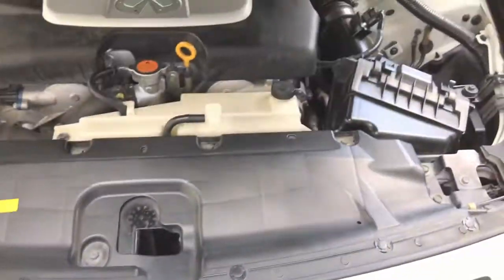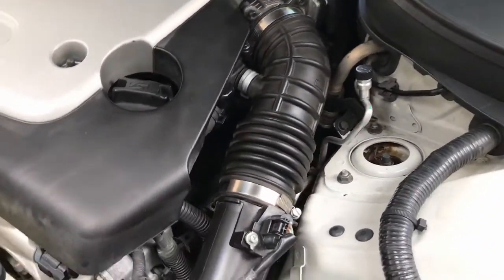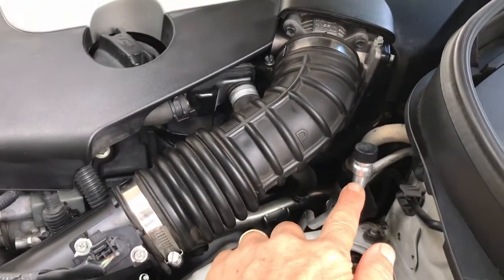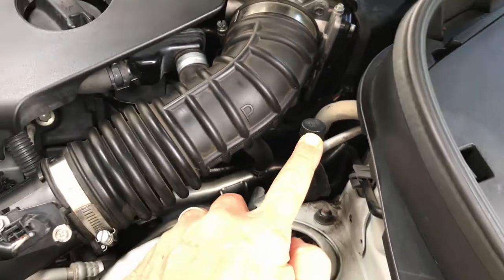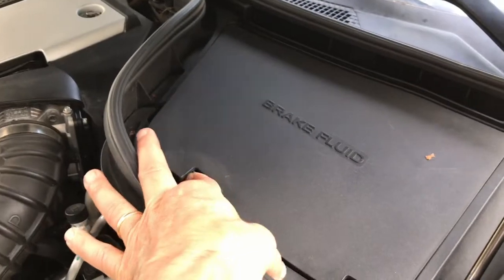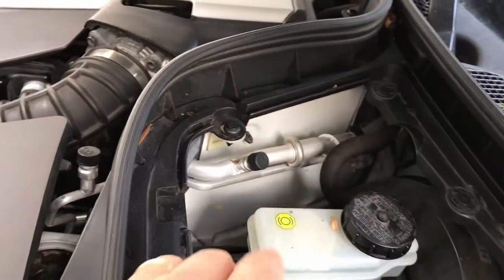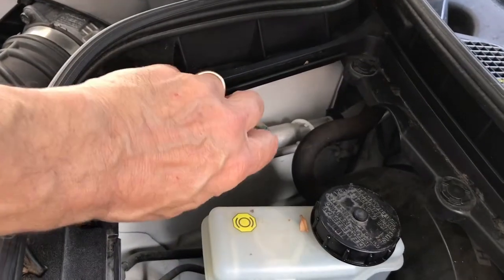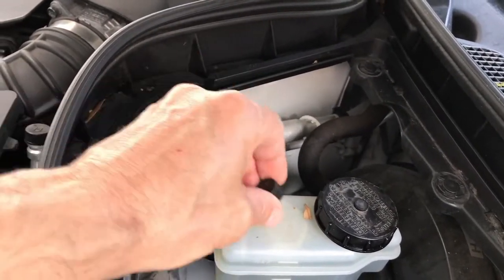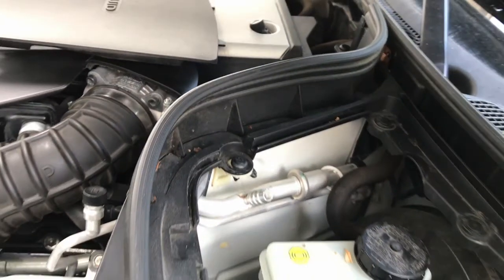Now let's identify our charging port. Here's one port under this cap. It has H on there, and it's a smaller of the two. That's the high side. We do not use this port. The low side port that we use for charging is under this cover. There it is right there. Cap has an L written on it. Unscrew the cap to expose the port. Let's put it someplace, right there, so it doesn't get lost. This is the port that we're going to use.